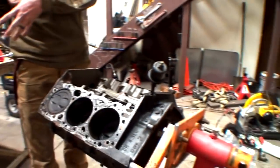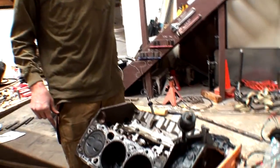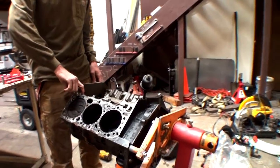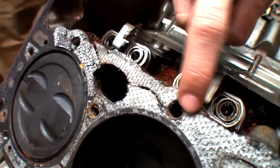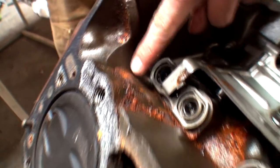These are cooled by lake water or river water wherever you're running it. The water comes in from the lower unit, the impeller in the lower unit - the outdrive. It pumps water up into the engine, into the intake, then down into the heads, and it cracked this block. The crack right here goes all the way into the valley - that whole wall of that engine cracked off all the way to the front.